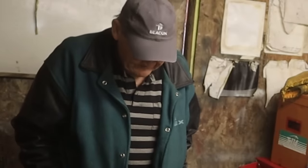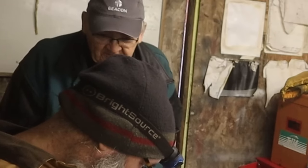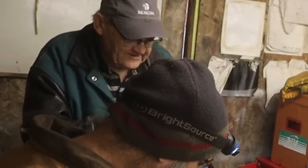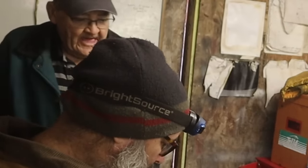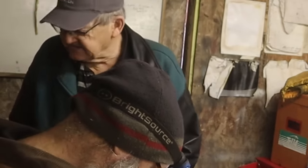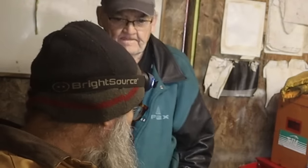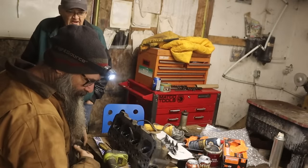So I had a rod that went on a tractor once, eh? I pulled the whole motor apart, and the aluminum all went onto the crank. You know how they do. So I took a piece of sandpaper and I just kept working it and cleaned it all back, until you can see when you got all the aluminum off, it's a different color. I bought a new rod for it, put it back together, and the thing ran like a dam. My neighbor had a John Deere with exactly the same problem. He cleaned his crank with a grinder. Probably didn't work quite as well. It didn't work at all. He had that crankshaft completely destroyed.